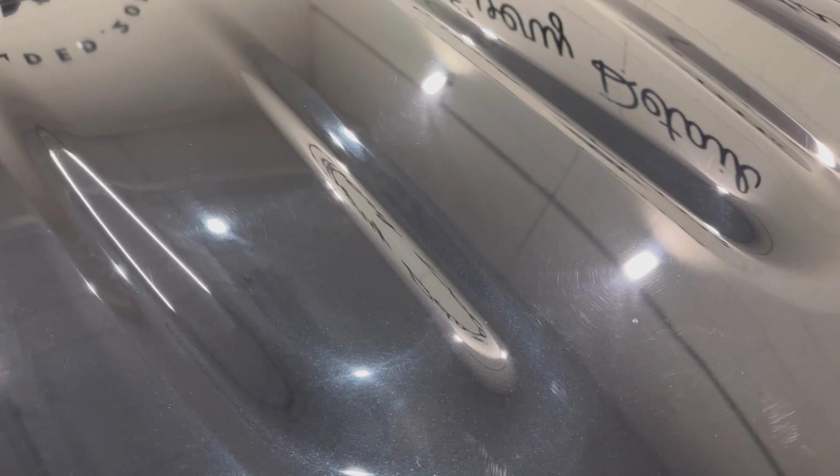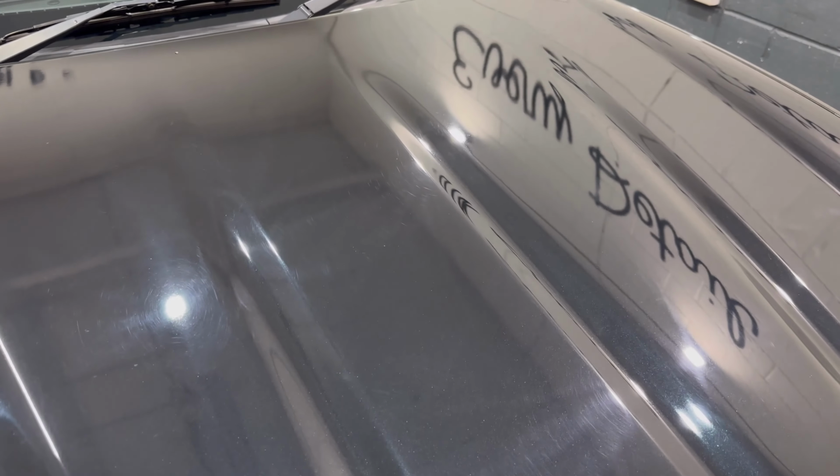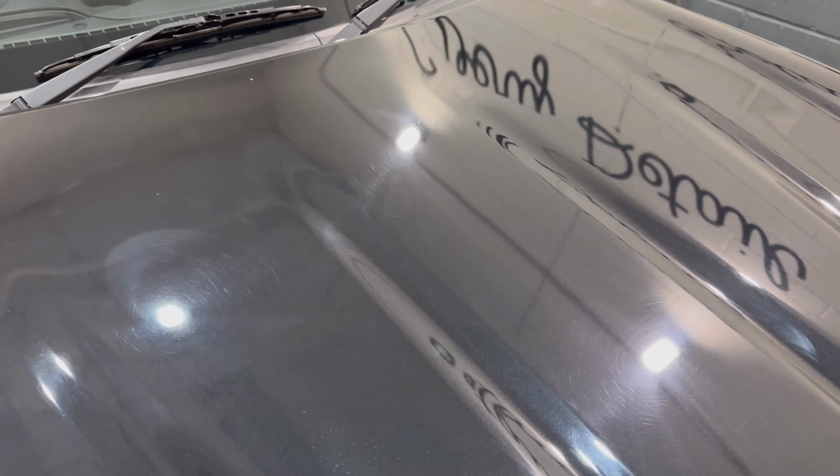Plus then they've all these holograms and swirl marks. And I think we had seen evidence of a cat walking along the bonnet before it was washed. So what's going to work on this bonnet might not necessarily work on the rest of the car because it's a different paint type. I haven't seen if any of the rest of the vehicle has been painted as yet because this is the one thing that just really stood out to me.